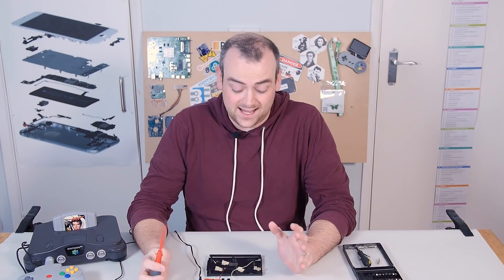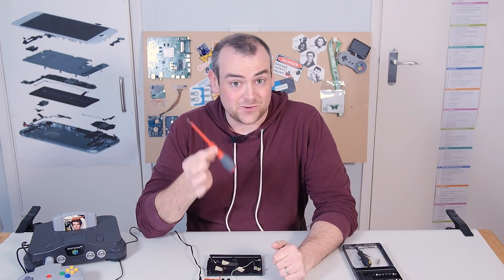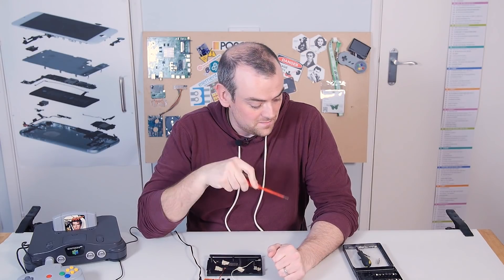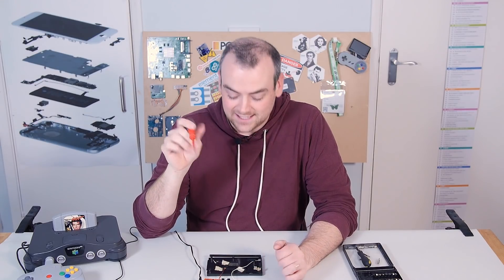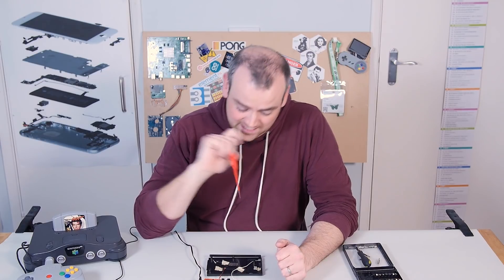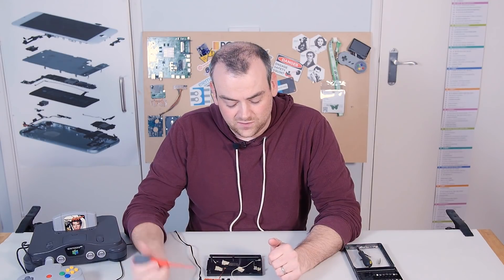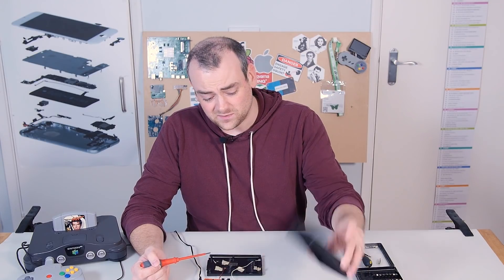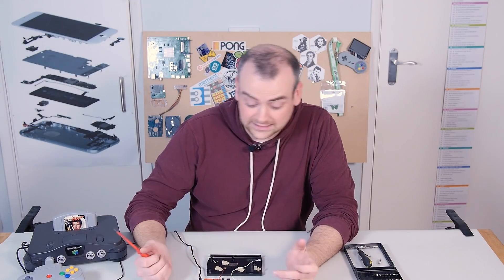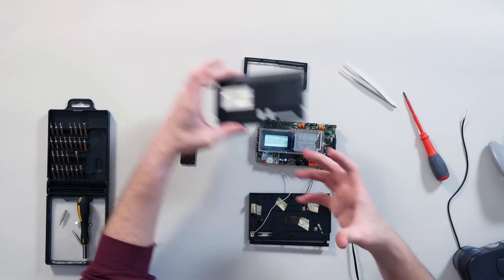As with all CRTs and all electronics, extreme caution when things are plugged in. I've upgraded to a 1000-volt insulated screwdriver and won't be touching anything but that and the glass on the front of the CRT. I know it's only a 9-volt source, but they step this up so much it's still very risky. You also have to be cautious about the type of radiation being emitted. There's no way to access these pots with the cover on, so this calibration must have been done in the factory.